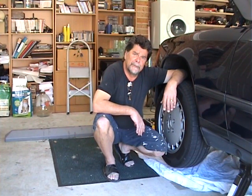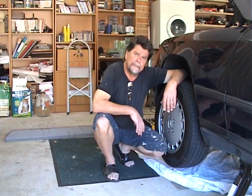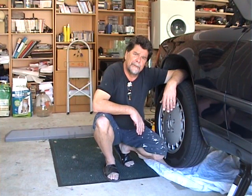I don't really feel like doing that, but the first thing I did was check under the car for oil leaks, and I noticed our low oil level sensor was leaking. Other than mucking around just changing a rubber, I thought it's only cheap anyway, $26 or something, I'll change the sensor. So first things first, we'll fix this little oil leak, and hopefully that fixes the problem. If not, it might be a head job on the car.